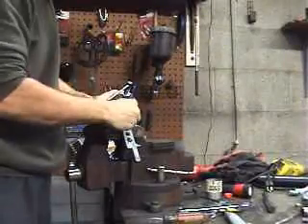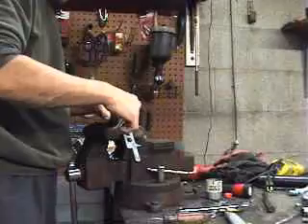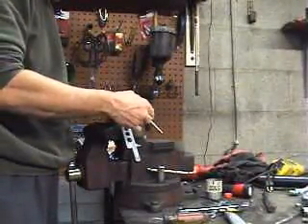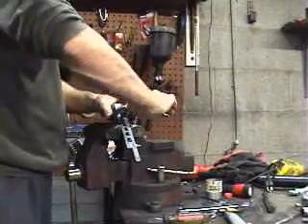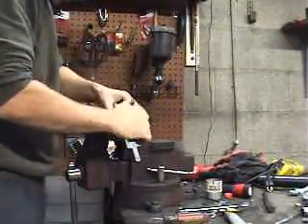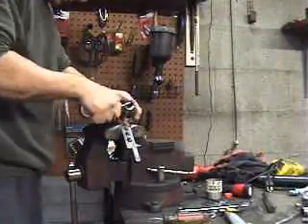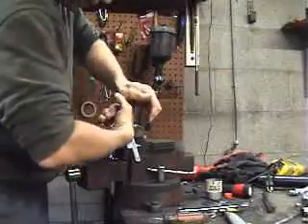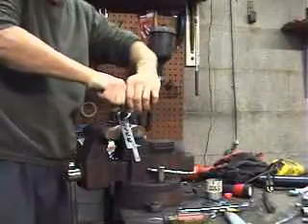Okay, loosen that up, get this out of there. Now that we've swelled it out with this, put this point right here in the hole of course, and what we do is we just clamp it down until it flares that tubing out into that chamfered hole in the vise that we've got the tubing clamped into. You've got to put a little muscle behind it — it's not too bad, but you just want to get it good and tight so that it makes a nice smooth surface to seal on.